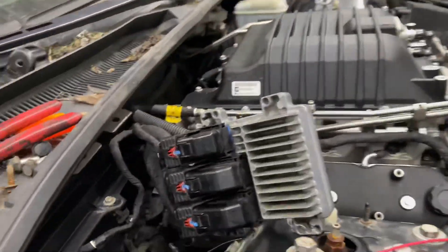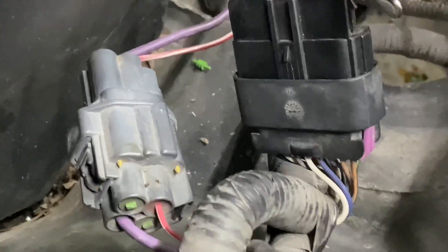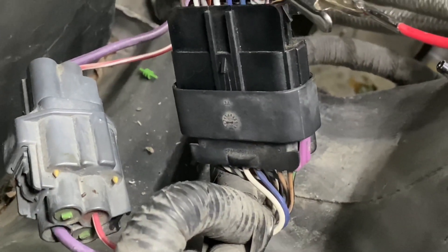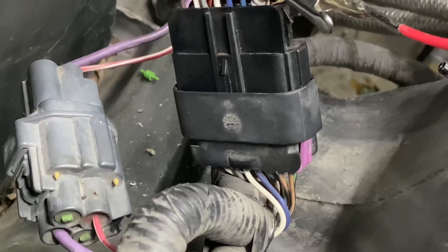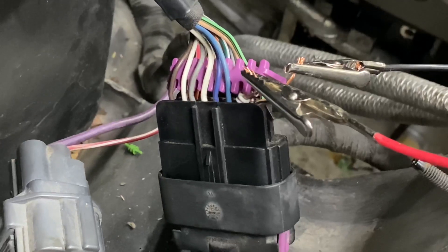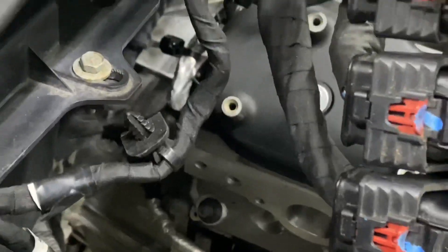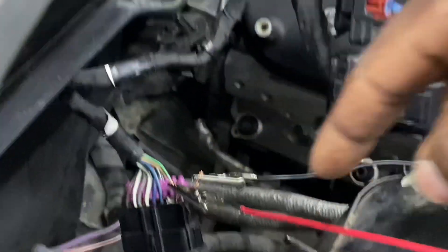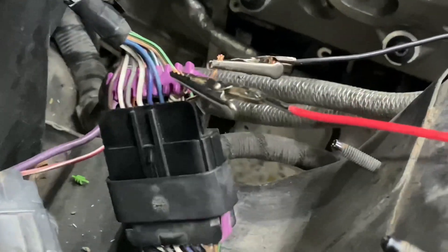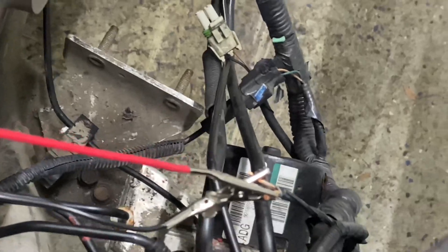As I had mentioned before, there were two circuits that were different from the V6 to the V8. The V6 had two pins — you can see them to the right, two tan pins — whereas on the V8 connector, the V8 engine harness coming in here and plugging into the V6, those two pins were not there.